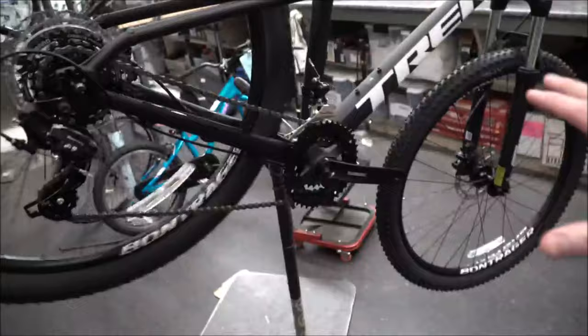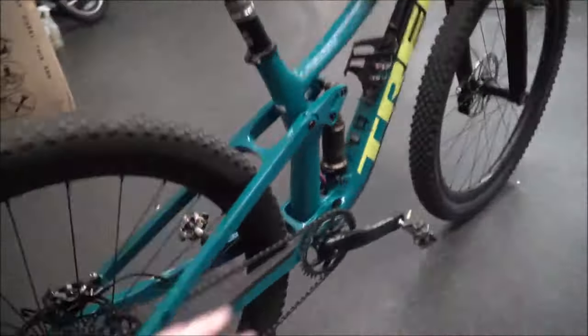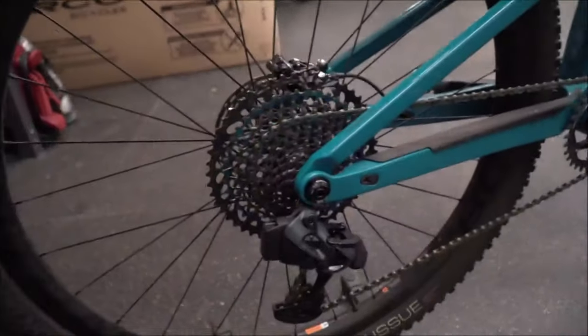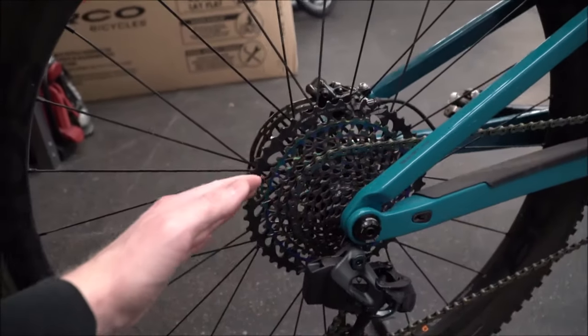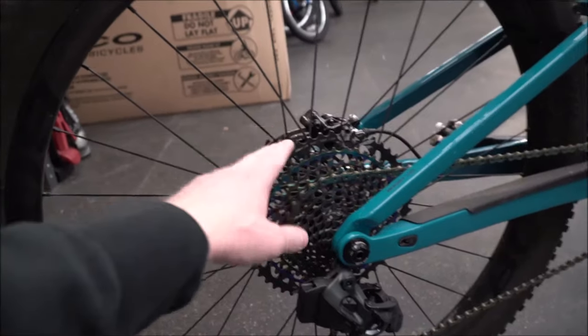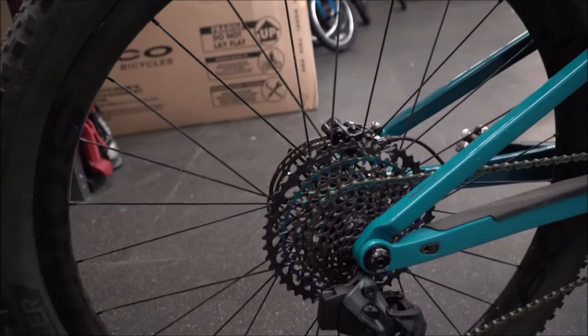With a low-end bike like this, you get a 3x9, lots of gears, small fine increments, made for fine-tuning what gear you're in, making commuting easy, and making the overall biking experience very easy as opposed to pushing towards a performance base. On something like this, whereas you may lose those teeny tiny increments which you had with a beginner bike, you might not need those smaller increments. You're able to jump through the gears at a much more rapid succession, finding and knowing exactly what gear you're in, and then you still have that big 50 tooth at the back to make it a really easy climbing gear.